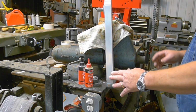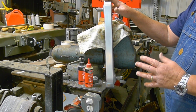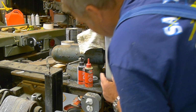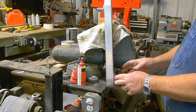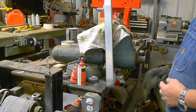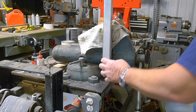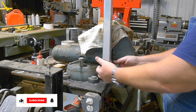So this is the Steer Clear unit, and I called the actual factory and talked to the owner and creator of this, and asked him, can I put both shafts on the same side of the Steer Clear? And he said absolutely. You just have to take out these screws, and inside the Steer Clear there's a chain, and you flip the unit around, you're able to have both shafts on the same side, which is what I need for the FC. They said to keep the unit in a vise securely so that the chain continues to fall down.